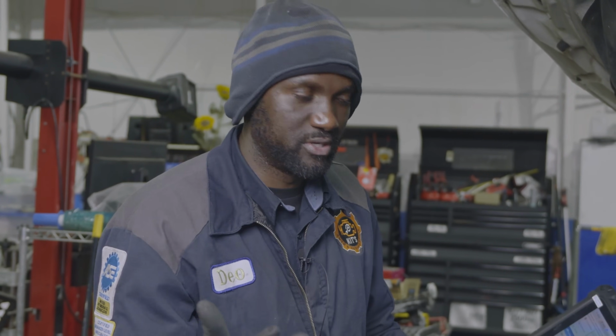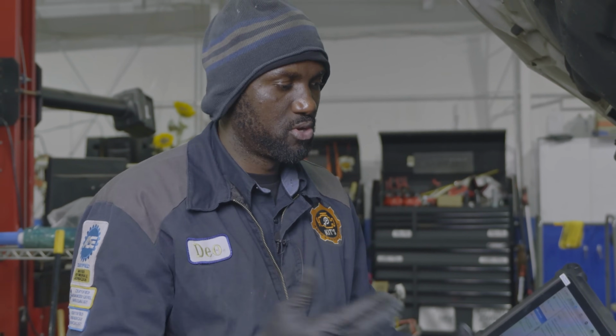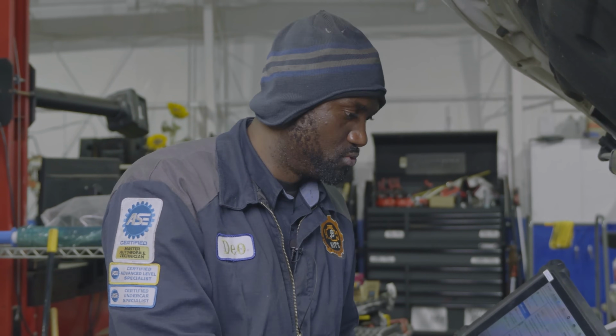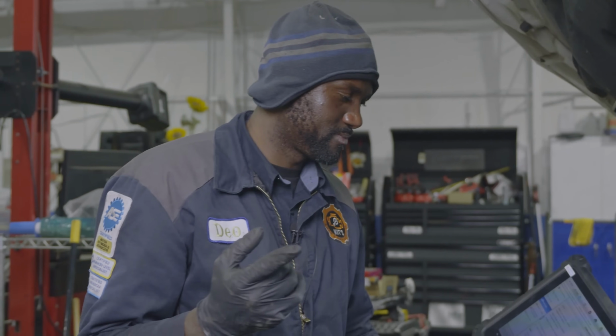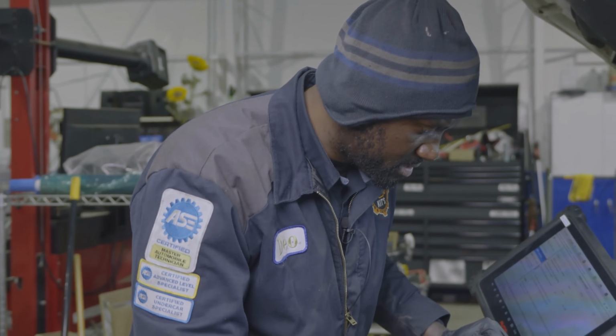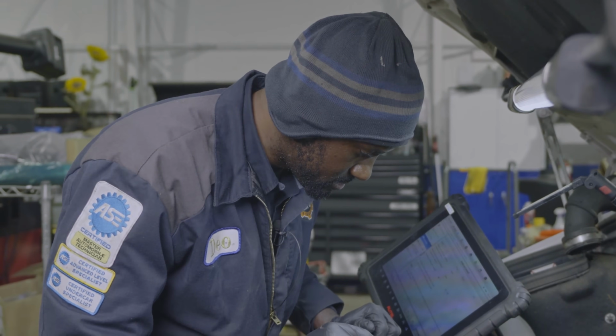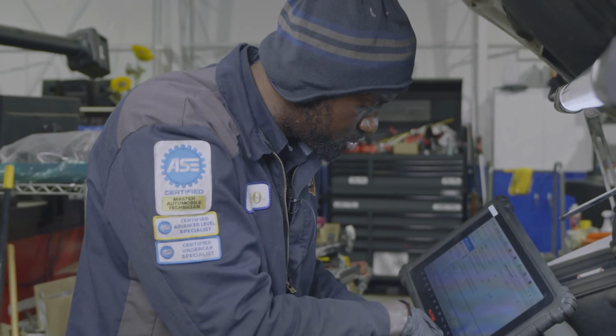Now what we need to do is we have to take the intake manifolds out and look at them to see if we can clean the flaps in the intake manifolds, or we have to replace the intake manifolds. The other thing we could do is we can use a camera that's gonna go into the intake manifold, but I don't know where we're gonna insert the camera. I mean, we can remove the EGR tube over here.